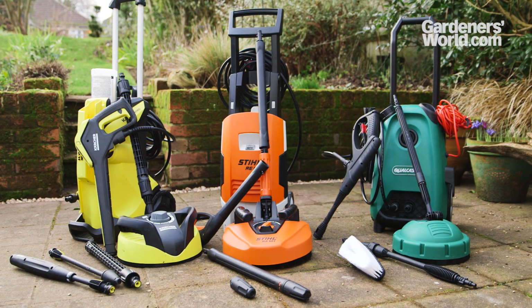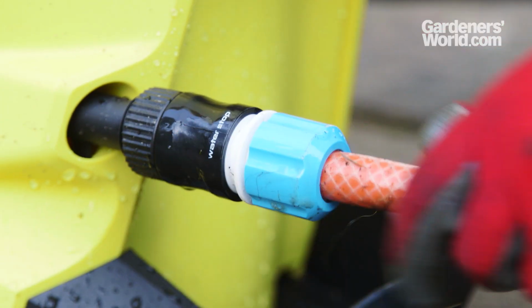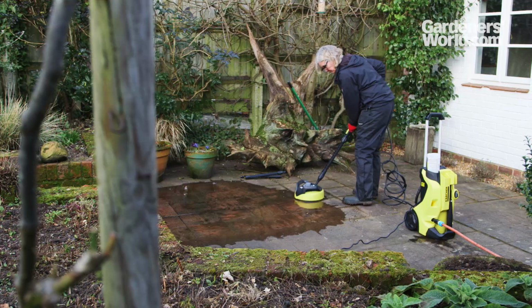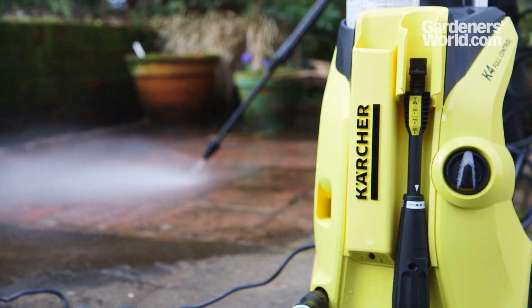The patio cleaner attachment for use on flat surfaces delivers 2 high-pressure jets on a rotating arm beneath the hood, which has a brush skirt. Rotating nozzles are used where the cleaning needs to be persistent but not too direct, for example over vulnerable mortar joints or old terracotta pots.